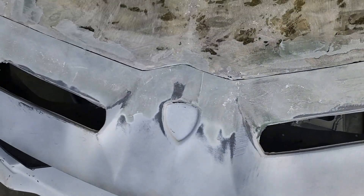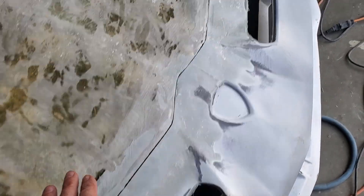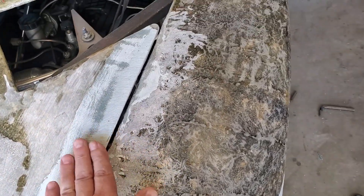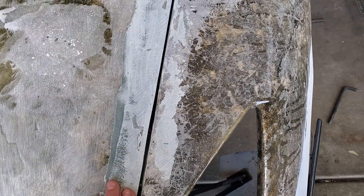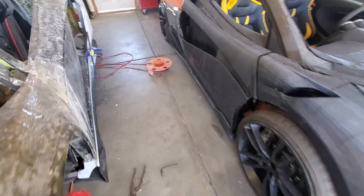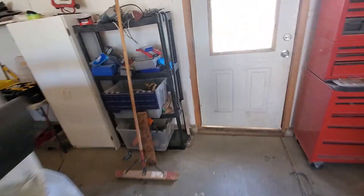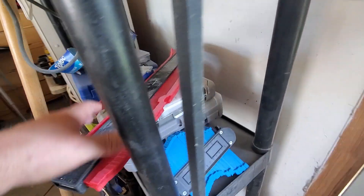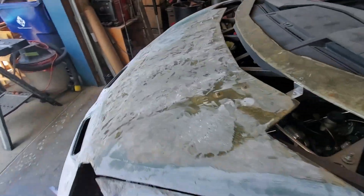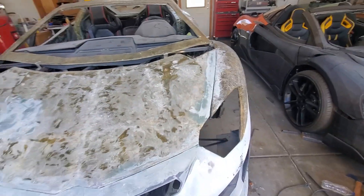We've got these kind of worked in here on the edges, but I need to work on this edge a little bit more — I want a finer gap here. I've got to use some of my shape tools, like these little ones here, and put those across the hood to make sure the shape doesn't change from one side to the other, getting everything nice and symmetric.